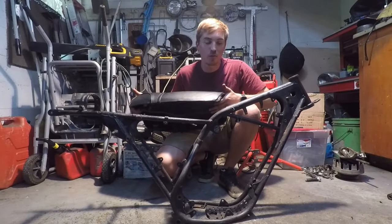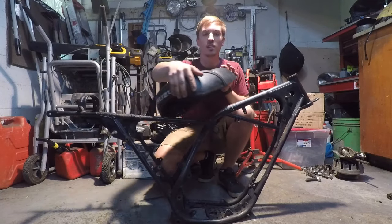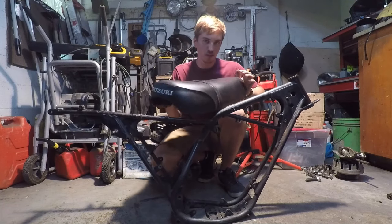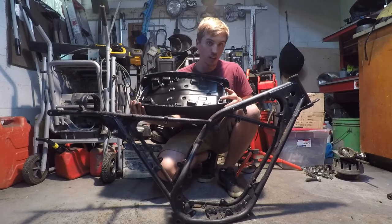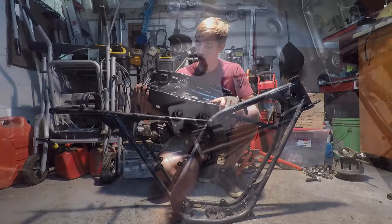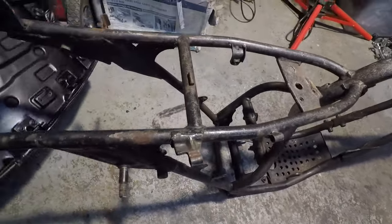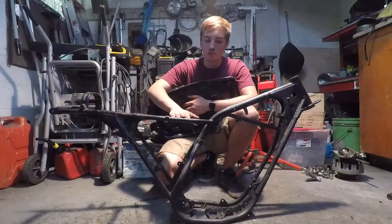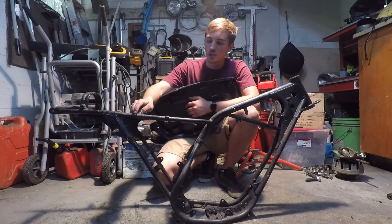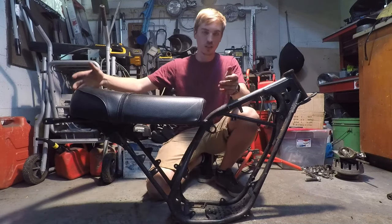If you guys remember from the seat episode where I restored this seat, check it out, link in the description or up here. This seat is actually from a TC185, and for some reason the hinges are on the opposite side of the TS185 seat, so that means that the hinge points here are on the opposite side of the frame. So the first thing I'm going to need to do to modify the frame is cut off these hinge points and move them on to this other side, weld them back on, and yeah. The seat seems to fit perfectly though, other than that.